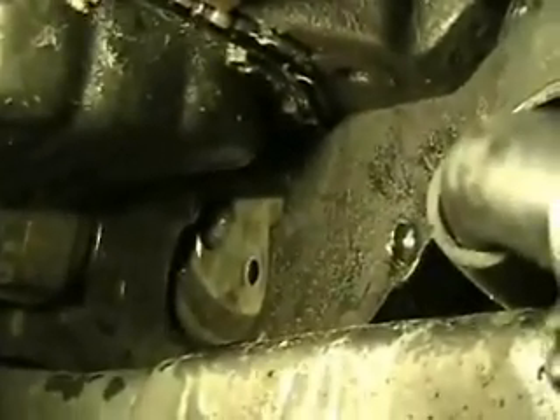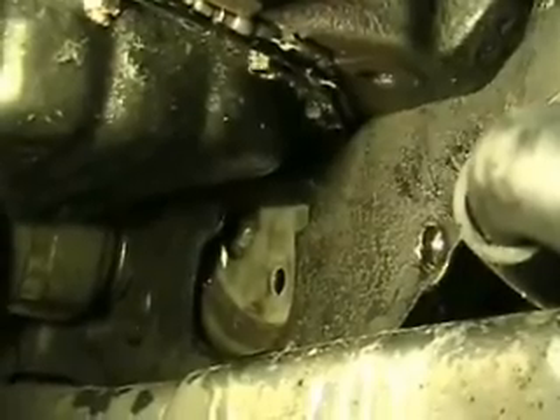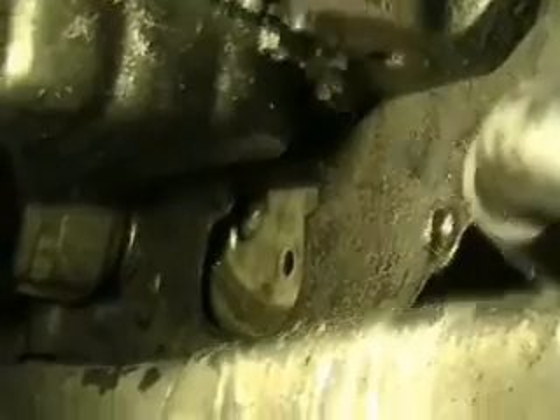There's another thing I want to do as well. When I get my bolt holes lined up here, you'll want to check your directions because on this model there's a special thing — it actually has a different colored bolt here, and this is the first bolt that goes in. The reason is that bolt helps line up the rest of the bolt holes, so that bolt is supposed to go in first. Also, know the torque setting — it's only 13 foot-pounds on this model. And finally, it takes a long time to finish this up because you can't just go in sequence to the next hole. Much like putting on a wheel or the flex plate, you've got to do this in a star pattern, torquing ultimately to 13 foot-pounds in a couple of steps.